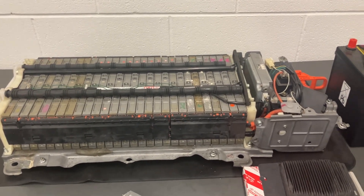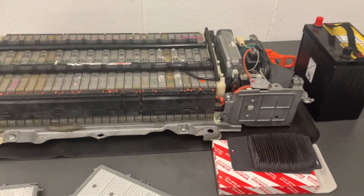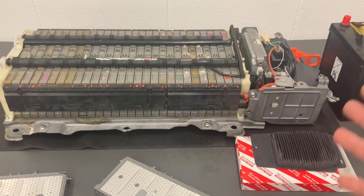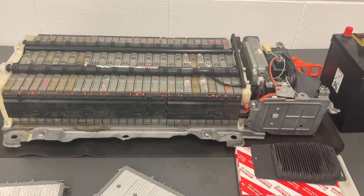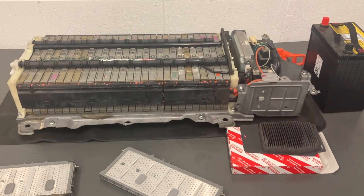You'll find some backstreet garages just take the service plug out — not advised. It's going to be fine 99.9% of the time, but the reason you don't go straight there is because you've still got high-powered relays with voltage wanting to leave the battery, and the possibility of arcing or a flash if it's damp or there are any faults with the system.